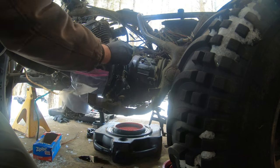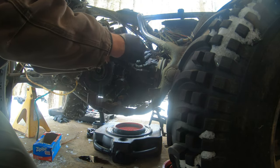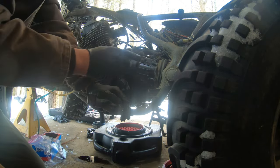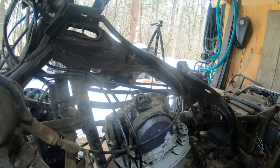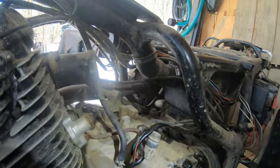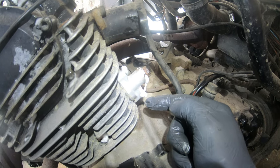I've moved around the other side here. I've been breaking out the bolts that cover the drive mechanism, because I do believe that to take this motor out I've got to disengage the rear end. Did get the engine stabilizing top mount off here. Have not worked on the exhaust yet - I'm going to hit that with some PB Blaster and let that sit. Probably hit a few more of these bolts also with PB Blaster - let them sit. And my PB Blaster is freezing up on the shade side of this motor - it's frozen.